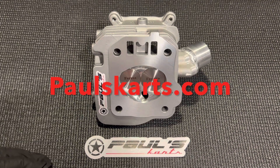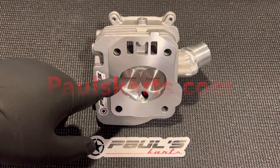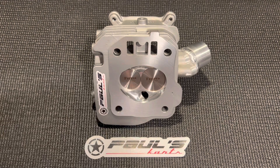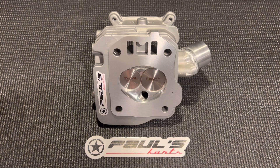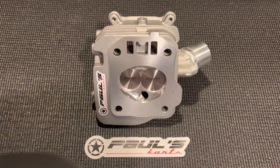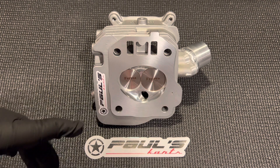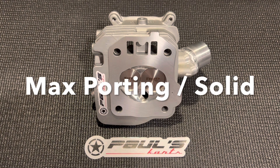What's crazy about this cylinder head is it has titanium valves and Moldstar seats. And I don't know if you guys can notice, but there's one other thing — can you tell what it is? There's something missing. And it's the oil passage. This has been welded and filled with a solid rod all the way through. That's basically a stage 2.